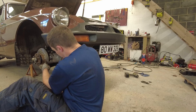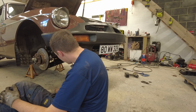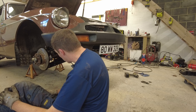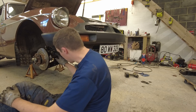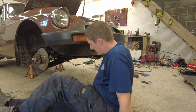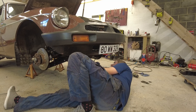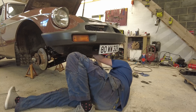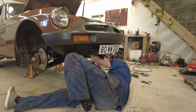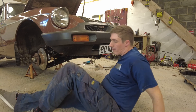As I said this track rod - they've never been used. I mean I'll have to try and take them off and replace them. You can get new covers, but still - Lord Jesus Christ. And the fact that the bushings are also showing signs of perishing as well. You can't win. Okay so there's the steering rack loosely in place - it's not going to fall out on me, but it'll give me enough wiggle room now to get the UJ on.